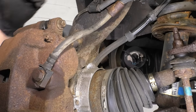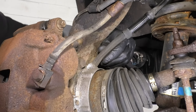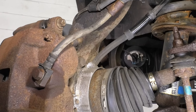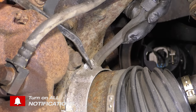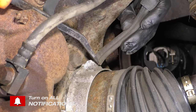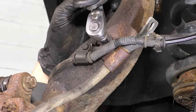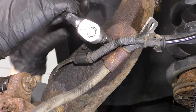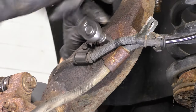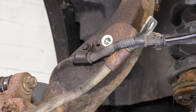With the wheel off, from the backside you can see the caliper that we have to remove. There's also a vacuum hose here for the hub actuator. I'm going to pull that off the hub now. You can use a screwdriver or pry bar to help pry it up and off. Then with a 10mm socket, remove the retainer bolt for the bracket that holds the brake hose on.